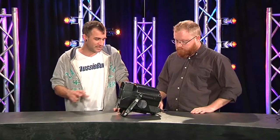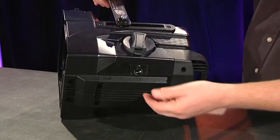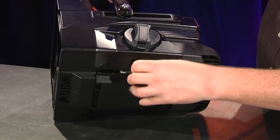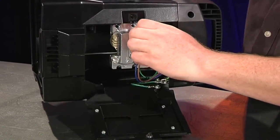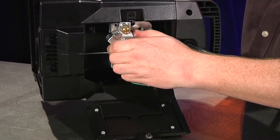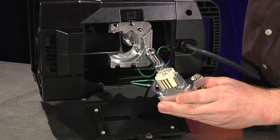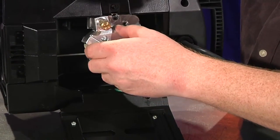The lamp mechanism — the actual lamp base and how you change the lamp out — is quite cool. You've got basically a micro-switched compartment down here, so that opens out, which is relatively straightforward to access your lamp. And that's a huge chunk of metal that the lamp is attached to — must be aluminium — pretty good for dissipating heat.